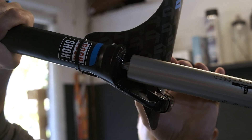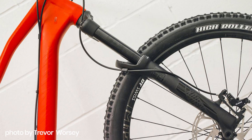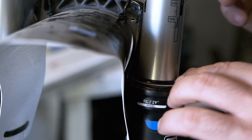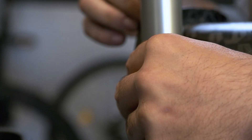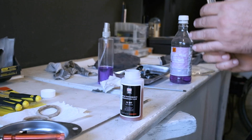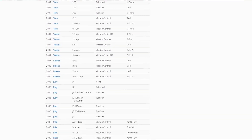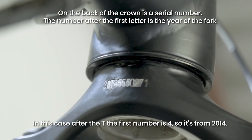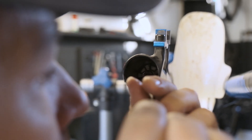Now the lower can be placed back onto the stanchions. Be attentive to maintain the correct alignment of the lower legs relative to the stanchions — do not insert it inwards. Do not insert the bolts yet. Get a pointy tool, preferably plastic to be safe, and pull down the metal rings to the rubber seals. This is not a hard process but take care if you are using metal near the stanchions. When ready, fill up each leg with 5ml of RockShox oil — you will need a syringe and a longer tube. It's important to check the data sheet of your fork; you will find the link in the description. Mine is a 2014 RockShox Reba so it only needs 5ml in each leg. After you are done with the oil, insert back the bolts — the red one in the right leg with the rebound adjustment knob, and the black bolt on the left leg.